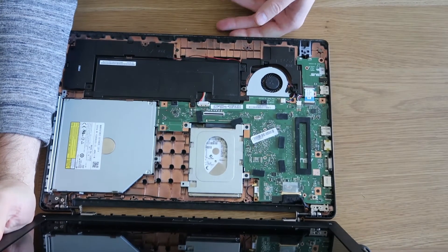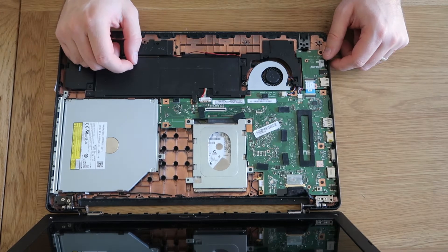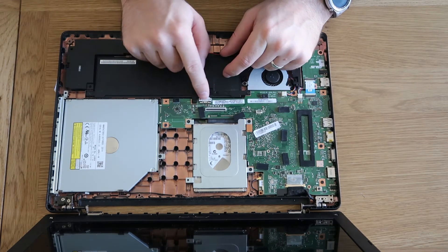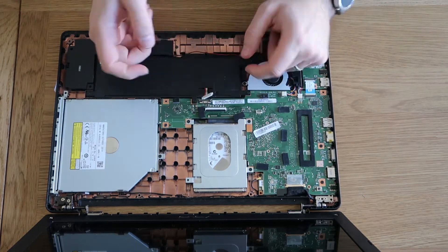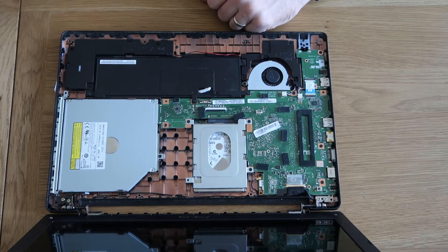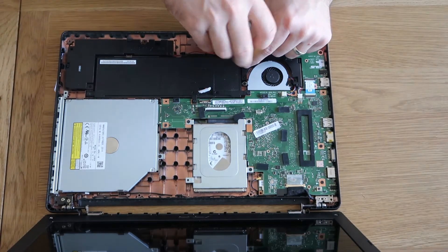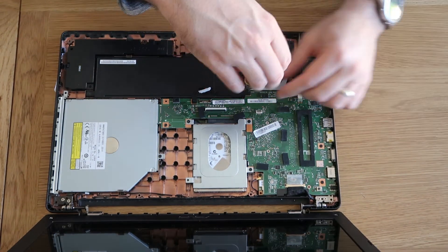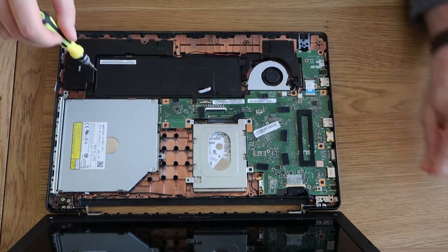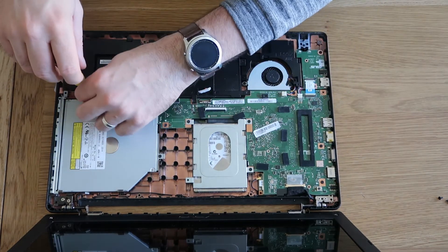So that's done. Here's our battery. This should, in theory, be quite a simple job. We can just disconnect this — push the little silver clip away and this should just pull out. That's as complicated as it is to detach the battery, and then we've just got to remove the four or five screws that connect it up. This is not a difficult job by any stretch of the imagination. Holding onto your screwdriver usually helps as well.